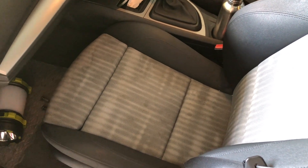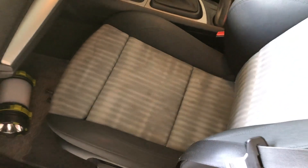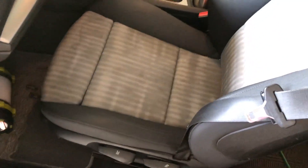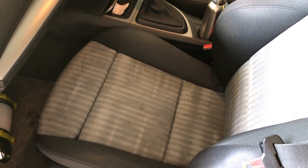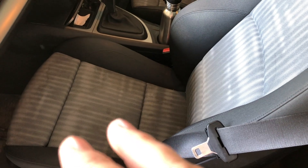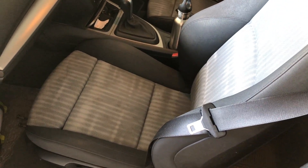I'll make this a separate video about why it matters and what goes on, and then a different one for how to actually put this in. It costs $400 in Australia - the seat mat is $400 plus GST, so $440 for a seat mat. They're very expensive, and it's half a day to pull the seat out. You need big tools - the T50 torx you can see down on the floor there. A lot of torx sets finish at T40 and T45, so it's inconvenient. But the simple fact is this is a safety feature and it can make your car extremely dangerous if you bypass that seat mat. It being expensive is not a good enough reason to not do it.